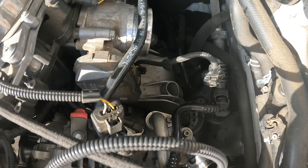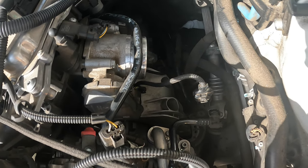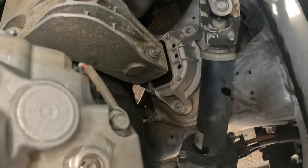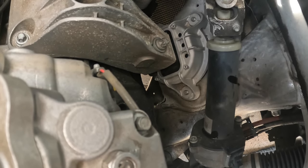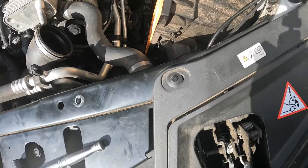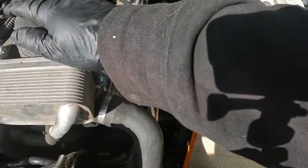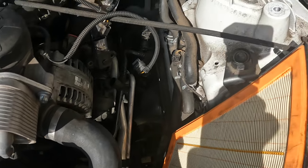There are going to be four bolts that hold this bracket to the engine — don't take those out yet, you want to take those out last after you have the engine supported. Down on the bottom you can see that little E-torx sticking out from the side going into your motor mount. Go ahead and take that one out if you want to, then once you're ready to jack up the engine you can take tension off and pull it out. We're also going to do an oil change, so you can go ahead and take the oil filter out too.